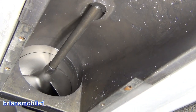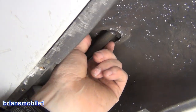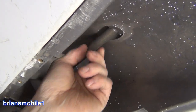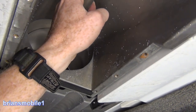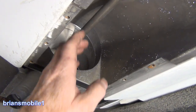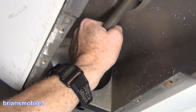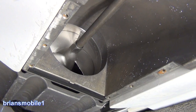On a Waverunner it's pretty easy. On a Sea-Doo and some of the other machines, they've got a really skinny area and it can really bind up a rope fast, especially if it's thick. If the engine's running, this part is spinning. If you run over a rope and it sucks it in, it'll stop the impeller. If the impeller stops, the engine stops, because there's a direct connection between the two.